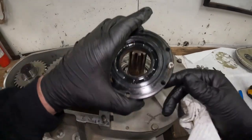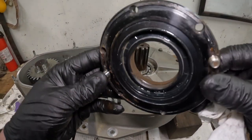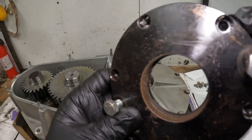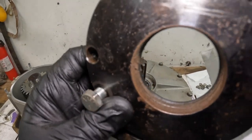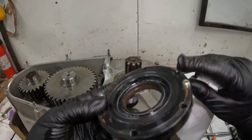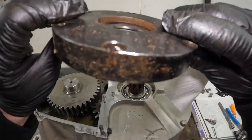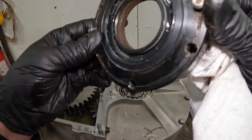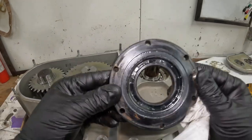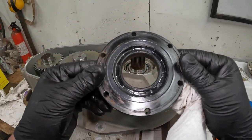The seal's out - the puck is out that holds the seal. It's probably got two seasons on it but you can see all the mud and crap that gets caked in there and it just grinds this out. I think the seals are only like 10-15 bucks a pop, so it shouldn't be too bad to replace hopefully. There's nothing to push it out on the other side, so I'm going to put it in the vise and have my way with it. I'll pull it out, measure it, and order them.